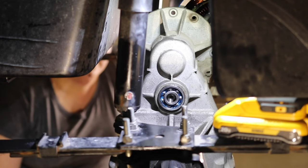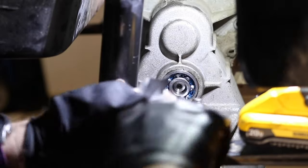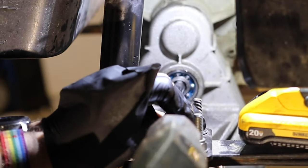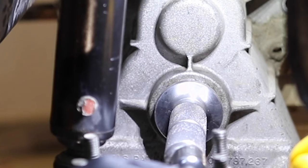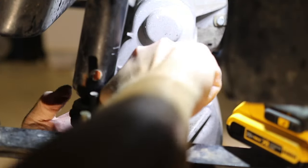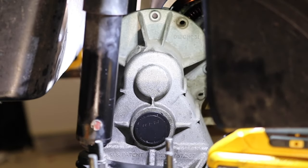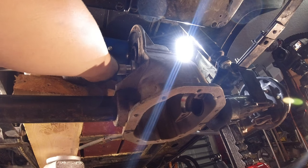I was able to put the snap ring in on the other side after I got the bearing slid in. Once I did that I was just using an extension to push the shaft in as far as possible. Before I used the bearing race and seal bushing driver install set - I'll link to that below, I picked it up off Amazon for $30 - it gives you the right size head to push those bearings into place. You can see I'm hammering that bearing in on the motor side. Both bearings stick into the housing a little bit, then you fit the snap ring in. Once you get those bearings in, put the snap ring in and then put the new freeze plugs on, using a dead blow hammer or extension to make sure you make a good seal.